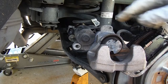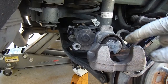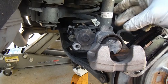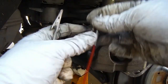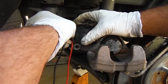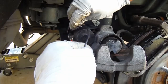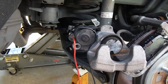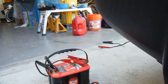All we need to do is put a 12-volt power source to this motor and that will spin it in. We're still going to need to use a special tool to compress this the rest of the way, but internally we just need this to go all the way in so we can turn and compress it. I've got a couple of mini alligator clips here — little terminals would be better to make sure they don't touch each other. You can see they're just clipped inside there, with the black one clamped in, and I'm using a car battery, but you can use any 12-volt source.